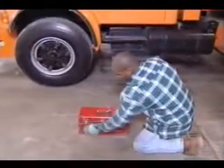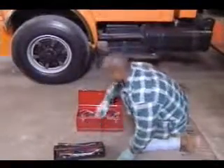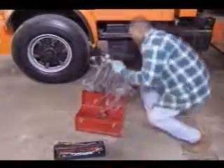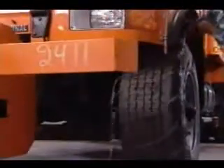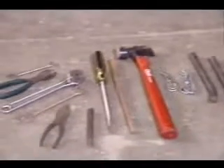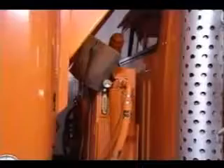We're now on the home stretch of your truck pre-season inspection. Take a look inside the truck toolbox. Check first for tire cables or chains — pull them out, make sure they are in good condition, and mount them to be sure they fit. Also, make certain the toolbox contains towing chains, extra plow and wing pins, extra pin safety clips, and the tools you think you may need out on the road. Check, too, that you have a hand shovel, which is usually attached or in a holder behind the cab or on the dump box.